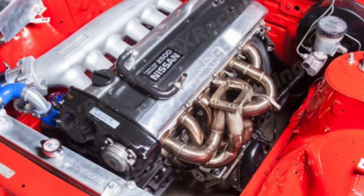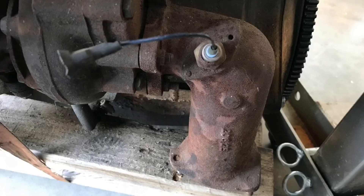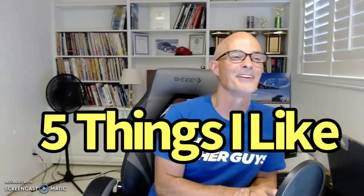A crossflow head on this would be better — the OS Giken one might have been one. If you look at the subsequent RB series, the intake and exhaust were on different sides, which just works out better. It looks better and packages better. So the non-crossflow head is definitely a minus. As for the fifth dislike, I actually only have four — because I was going to talk about the exhaust manifold and downpipe, but that's actually on the plus side. I like the way Nissan designed those. You can hook up a variety of turbos, the downpipe size is generous, and you can make lots of power.